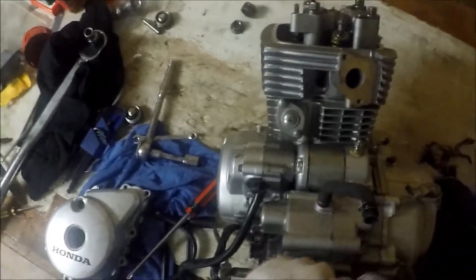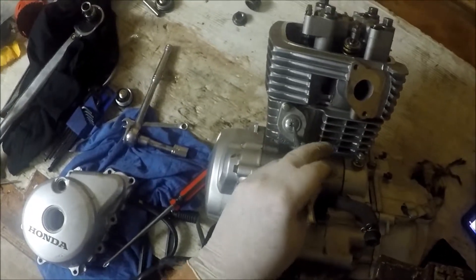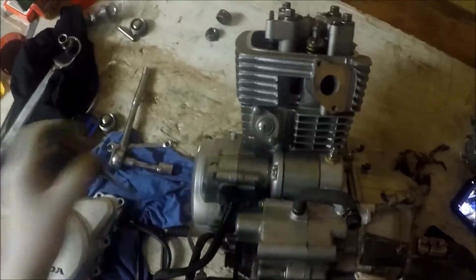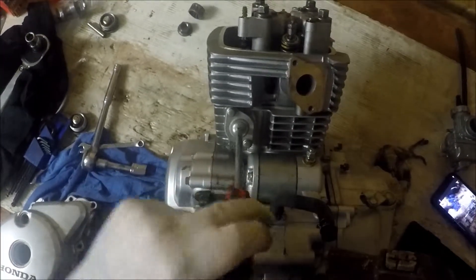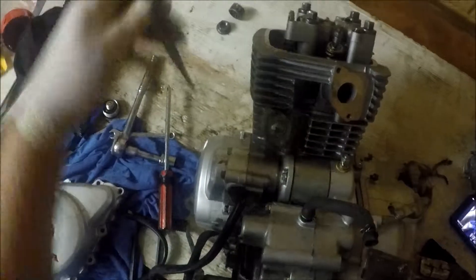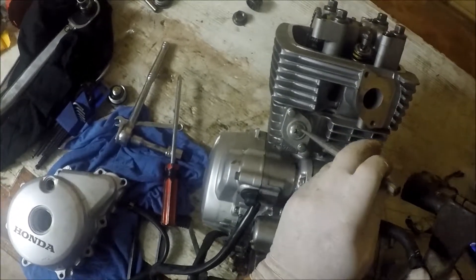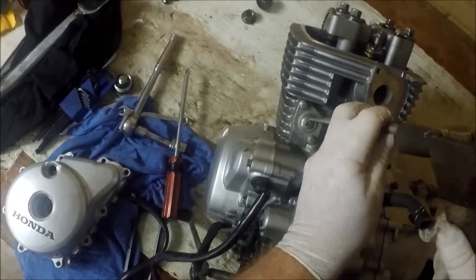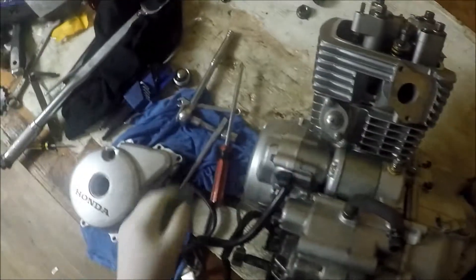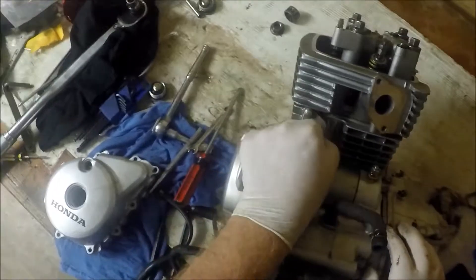First up, if it hasn't been removed ever, it's probably going to be a little bit hard — as in tight. We need to get this bolt off so that we can reset the tensioner. If you've got the right screwdriver and it works, that's great — it shouldn't be too tight. However, if it hasn't been removed before or the last person who did it was enthusiastic, what I've found is just to pop a little pin punch mark in there and then gently loosen it by tapping on that. Don't go nuts, don't rip it to pieces. Once you've done that, just these two bolts to remove it.